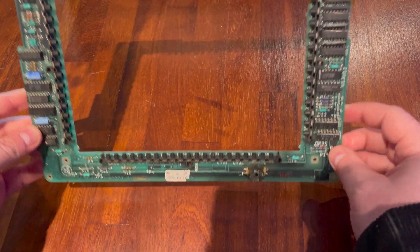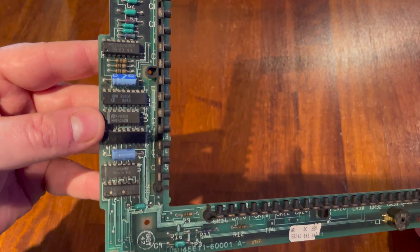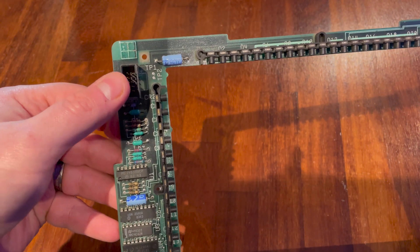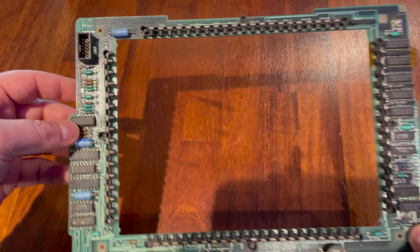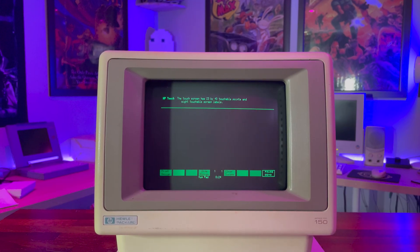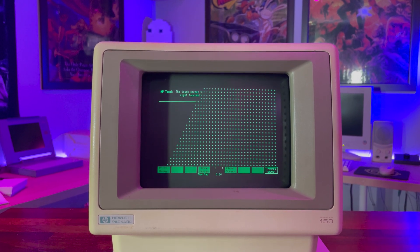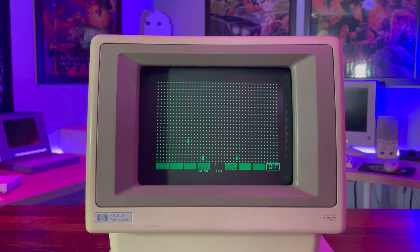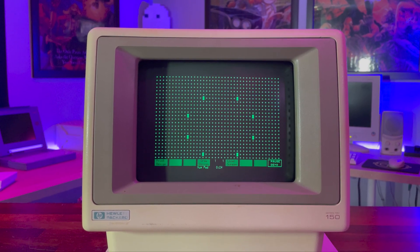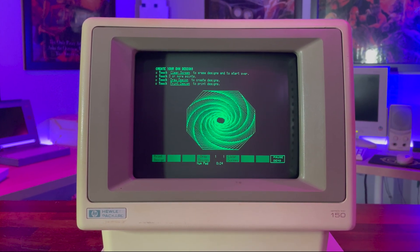You can see how this works in more detail if you look at this spare bezel included with this machine. The infrared diodes are in these rows around the edge, and the changes in state are fed into these multiplexer chips, with the outputs sent via this 10-pin connector on the edge back to the system board. The resolution of the matrix is quite small — you only have 14 rows and 21 columns, meaning just 294 touchpoints on the screen. So the software has been written in such a way that the on-screen options line up perfectly with the emitters, making the best use of the rather basic touchscreen.